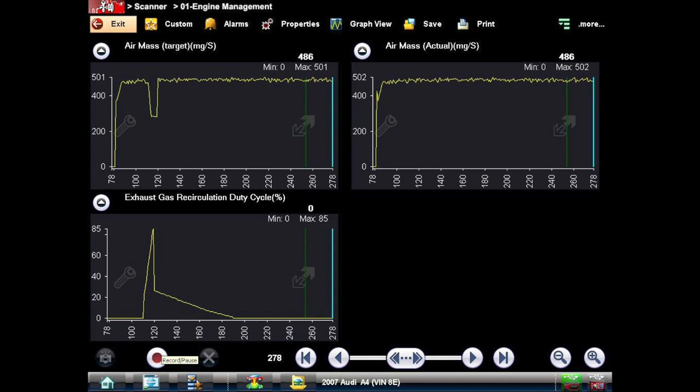So I spoke to Dingbro, and they said this is a common failing on this car because of how it's positioned, because the electronics are at the bottom, and all the engine oil or turbo oil, whatever, finds its way into that circuit and it shorts it out. That's why it says on there it was a short to power or something like that, so I need to change that. But in saying that, I don't think the EGR caused the DPF to block up. I think it was because there was a hole in the header tank and it wasn't getting up to its proper operating temperature, so it therefore could not do a regen because it couldn't develop enough heat. But in saying that, it's done that Innotec stuff fantastic and has cleared it, so we'll change the EGR valve. Cheers.